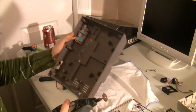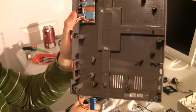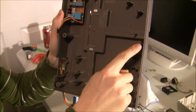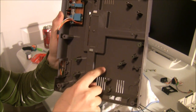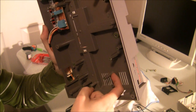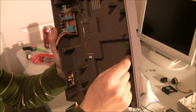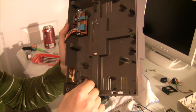I've marked in green all the areas that need to be drilled down. All of these little pegs, with the exception of this one, are just meant for the internal components, so I'm going to drill those down. The goal is to drill them down as close to the base as possible, so I can maybe relocate some of these to be motherboard standoffs for screws. Only removing as many as necessary, just to keep the structural integrity intact.